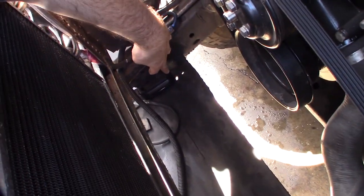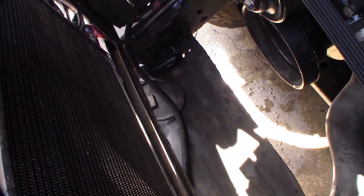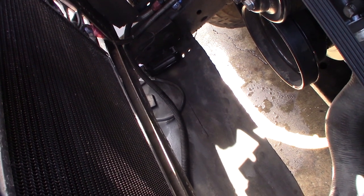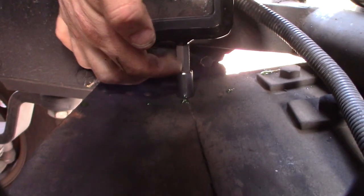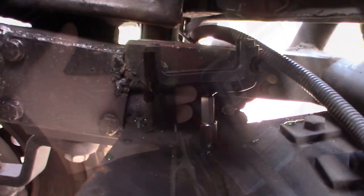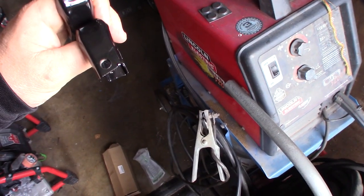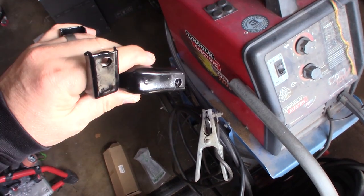I got the brackets in, and this metal plate was probably put in about 30 years ago by the previous owner. I'm not sure what the stock bracket even looks like because this is the only one I ever had. My radiator brackets weren't high enough, so I had to build some standoffs — just a spacer and one of these double-threaded nuts. I had to cut those down — those are the original ones I bought — and I had to weld some nuts on there.